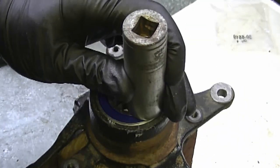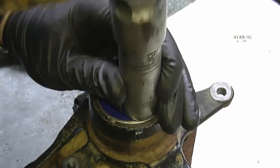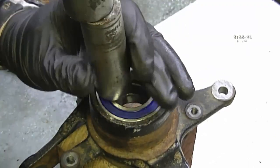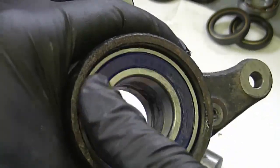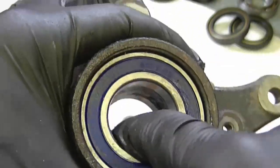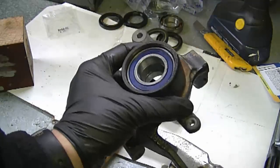I keep repeating that because it's imperative — if you do tap the inside you may have to buy new bearings. I'm going to use the socket method like I did on the other one, tapping just the outer part. Before you're done tapping the bearing all the way in, you can reach in and line up the spacer with the bearings so that when you put the hub in it goes in perfectly. I've heard of people who had a hard time getting bearings in — they stick them in the freezer overnight because it shrinks the metal a bit so they go in easier. Others heat up the yoke where the bearings go in so it expands and the frozen bearings slide in easier as well.